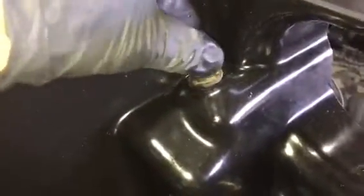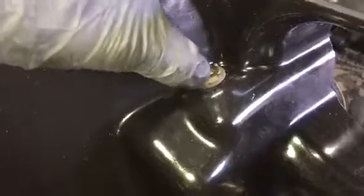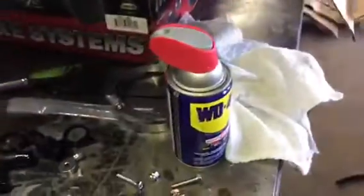One little side note, these are kind of tough. I don't know if it's because I live in Arizona and the truck's an Arizona truck, but the rubber was really tough on here, so go ahead and get yourself some WD-40 and that'll help you install all 3 grommets into the plastic. The very next step requires us to install this box using the original mounting locations and go ahead and torque those bolts down pretty good.